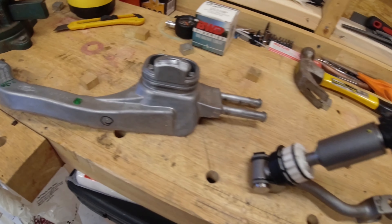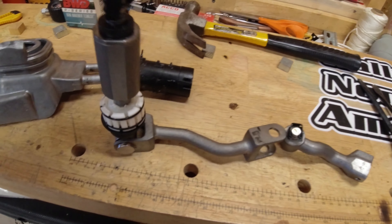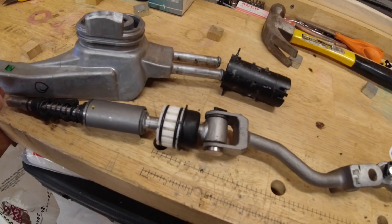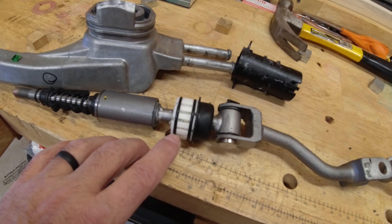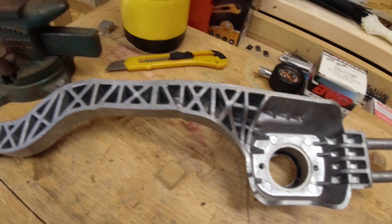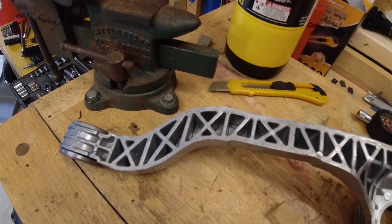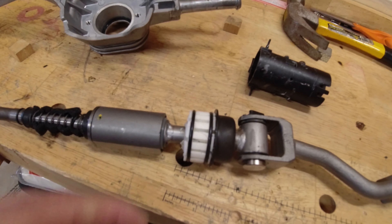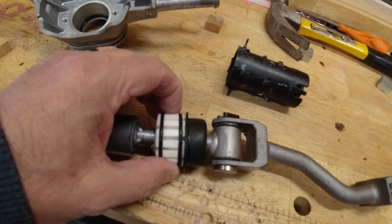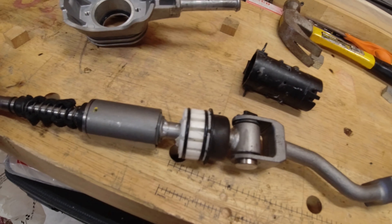This is the actual Ford shifter itself — this is the body of the shifter. If you look at this neoprene gasket with the o-rings on it, I think that's where your vagueness comes into play. This looks to be cast aluminum, which does a decent job of supporting the shifter on the car, but this right here is where I think the letdown is on the shifter. This allows for play — it's not precise. It's just kind of shoddy.